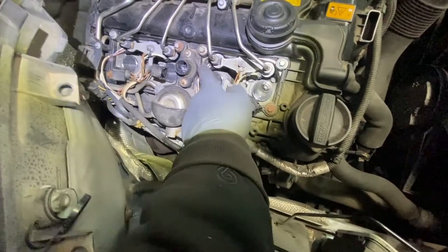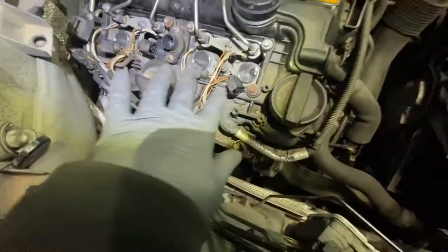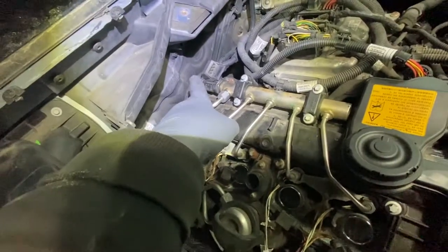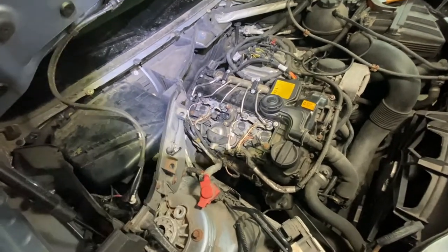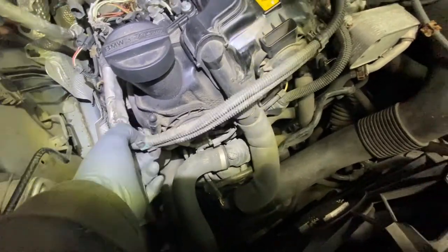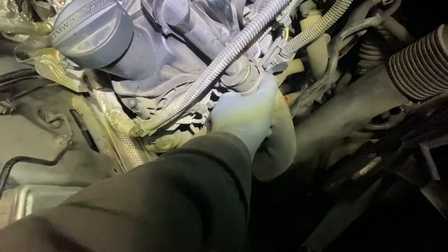After the coils, there are injector wires, ground wire, and cam sensor wire - take those all out. This is the harness over here - this whole thing you have to release and move out of the way. The hardest part is going to be getting the bolts off the vacuum pump in the back. Pull the wires away - they have little clips that slide in. PCV vent over here has little tabs on both sides - push them in and pull it down.